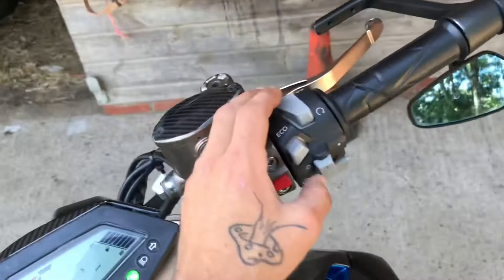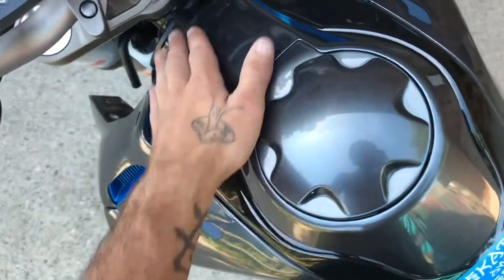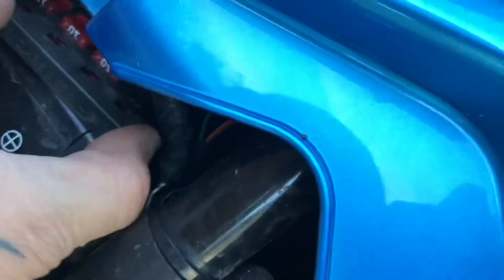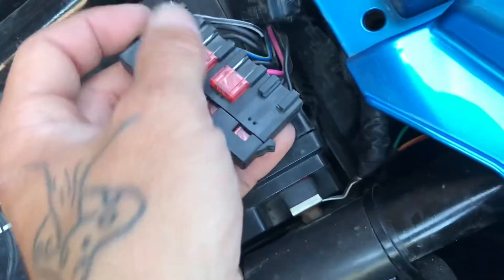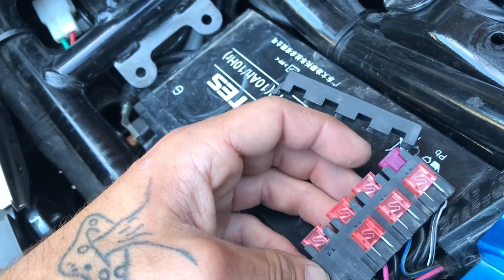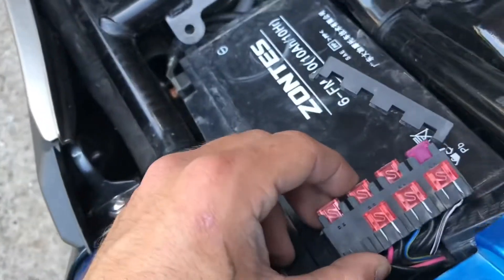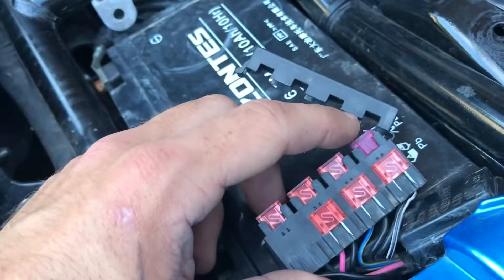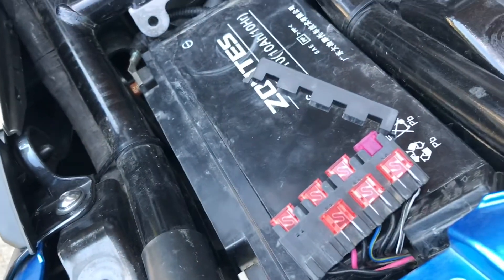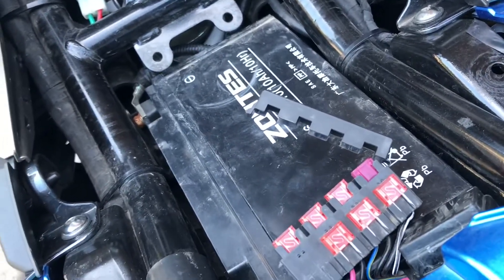All of a sudden I realised — when you flick on the ignition switch, you can hear the fuel pump engage. I then realised the fuel pump's not engaging. I thought, oh fuck, my fuel pump's gone. But I had a little look under the seat — under the seat here is where you'll find relays, fuse boxes, and your main fuses: ignition, starter, fuel pump, lights, indicators. The starter fuse had blown. I had one spare on me, put that in, and it blew straight away. I was really confused. They just kept blowing and blowing every time I put a fuse in — I used all three spares I had.